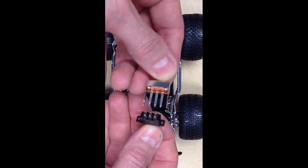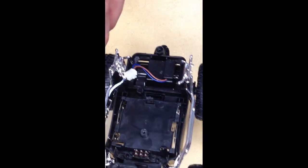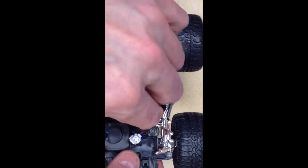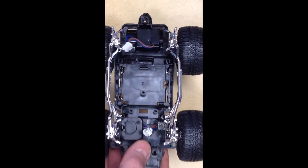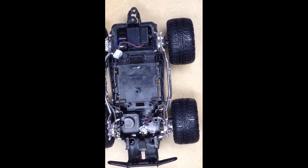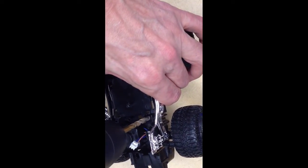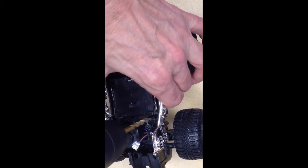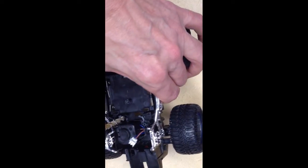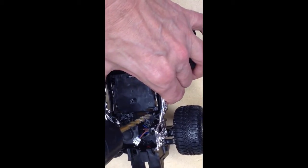We'll try and place this switch into the hole where the original switch was. It's a little bit tight but you can see where it belongs. One of the problems is that this switch is impeded by a couple of studs here that we need to remove. I'm going to take a drill with a bit big enough to drill those studs out and just remove them this way. It's a tight space — you have to hold the drill very straight, and be careful not to go through the bottom of the car.